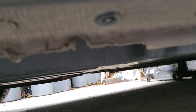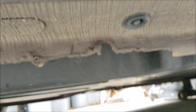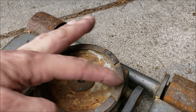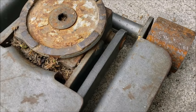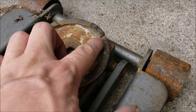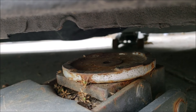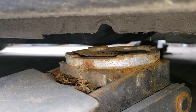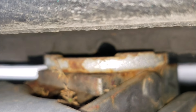And the same goes for when you're lifting the rear half of the car. The pinch weld lifting area for the rear begins here, and you want the notch of the pinch weld to sit in the middle of the jack's cup. You want the pinch weld to sit in the middle of the cup with the raised areas able to grab onto the pinch weld if the jack begins to slide back as you lift it. You will notice for low profile jacks, they don't have much of a raised area, which makes it easier to fit into low vehicles. Now to begin lifting the vehicle — you want the cup to sit in the middle of the notch, just like that, with the edges of the cup surrounding the pinch weld so that it doesn't slide off.